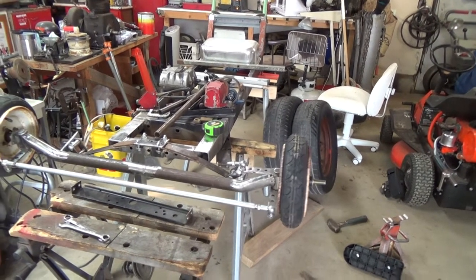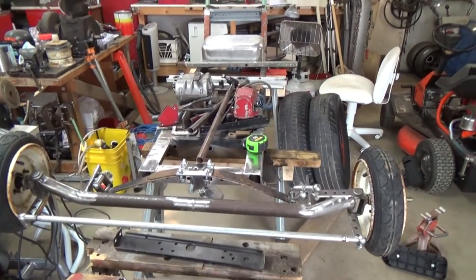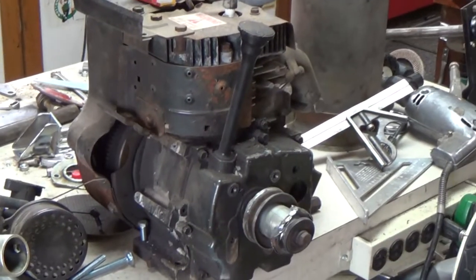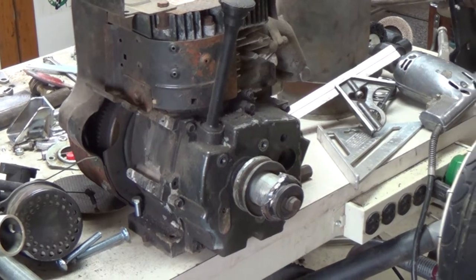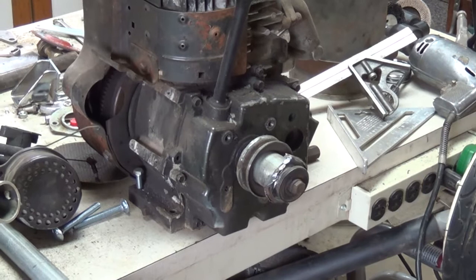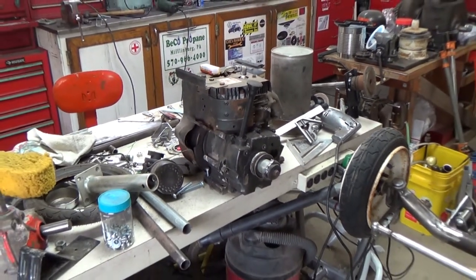Well, we're making progress, and I just did want to make one question. One of my subscribers, and I can't remember who it was now, said he thought he might have a 12-volt starter for this 8 horsepower Tecumseh that I'm using. And at the time I had told him I couldn't do it because it was going to interfere with our transfer box over here. But I have realized since that all I have to do is put some spacer blocks under the motor, and that would give me enough clearance. So whoever that kind gentleman was that made that offer, if you could contact me again.